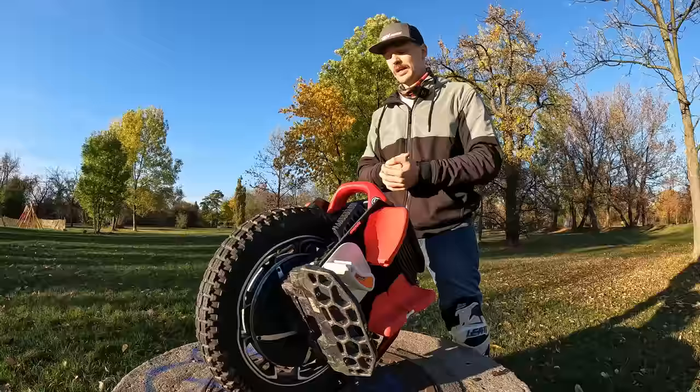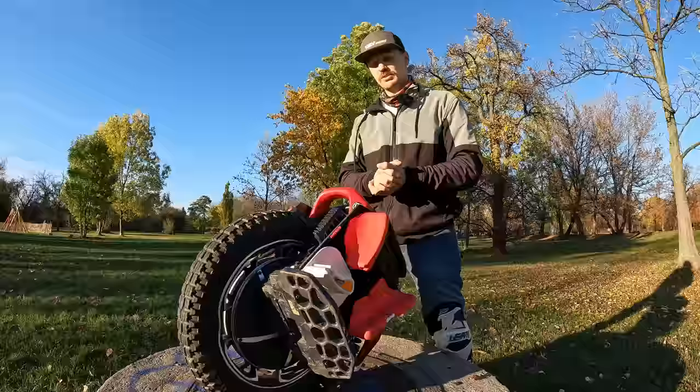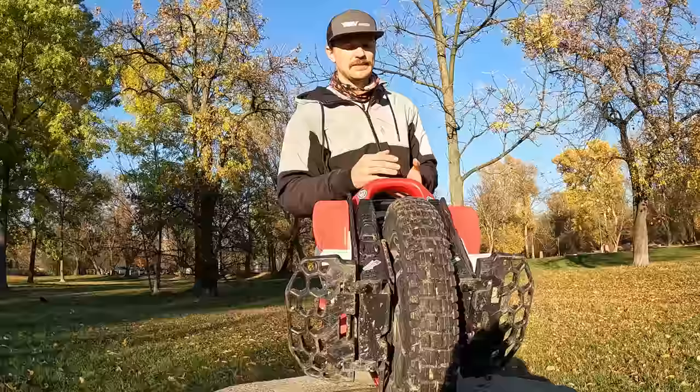If it gets too warm, except for this weird phase wire issue, it should tilt you back. Low battery tilt back, too high speed tilt back. So this is a suite of things that is really nice and a must-have to be in a proper electric unicycle. Last but not least on safety, well, it is coinciding a bit with durability. The fact that Kingsong decided to use 125 volt MOSFETs.